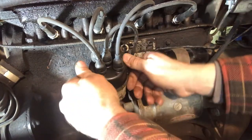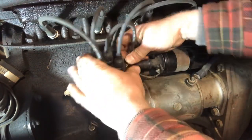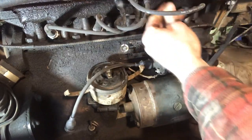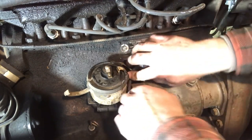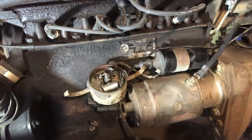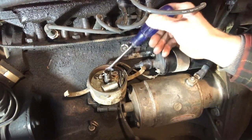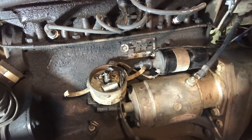It is really important — make sure the key is off. Pop the cap off. I am going to unhook the coil wire and put it out of the way so it won't be in the way. We'll take the rotor out and the little cover. So now here is your condenser and points. Out of habit I touch this metal here and try to touch the frame to make sure the capacitor is discharged. It really should be fine, but I just don't feel like getting a shock.